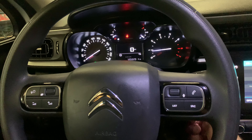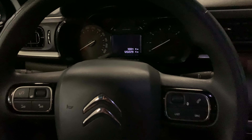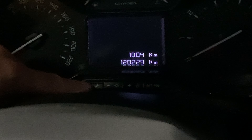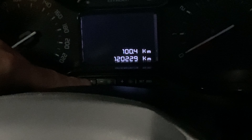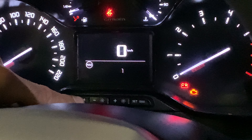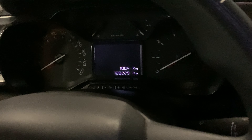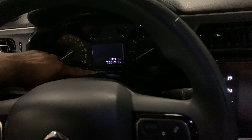Okay, let's start. First step: turn the ignition off. We have three or four buttons over here — we're going to use the button with the wrench on it. Ignition off, press this button, ignition on, then you see a timer counting back from 10 to zero. When it reaches zero, let go of the wrench button. The service indicator should now be gone.